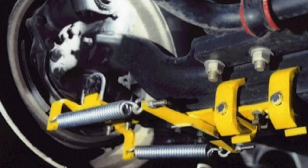As you can see, there are springs that go in front of the axle spindle and then behind it. What it's really doing is preloading — providing tension on the front wheel so that if it turns, it expands the spring on one side and contracts it on the other, and naturally pulls the wheel back to center. You could think of it as a self-centering device.